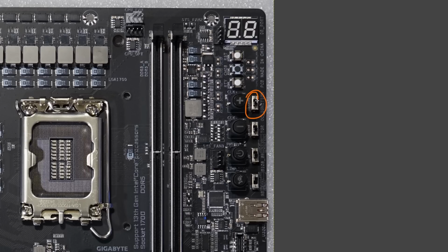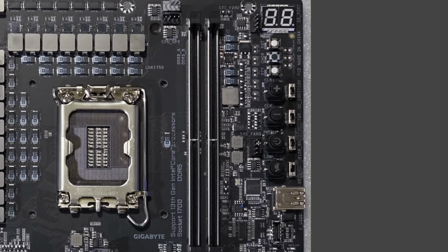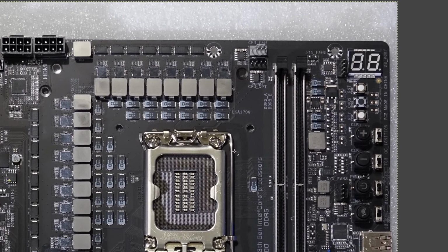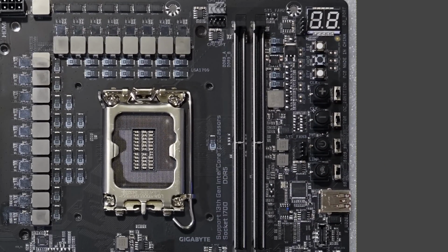But for filling water cooling loops, no. I would strongly not recommend using this for filling water cooling loops, because it doesn't solve the main issue: your motherboard's still getting high voltage to it, by which I mean 12 volts. Relatively speaking, in motherboard voltages, 12 volts is the highest voltage you regularly see on a motherboard.